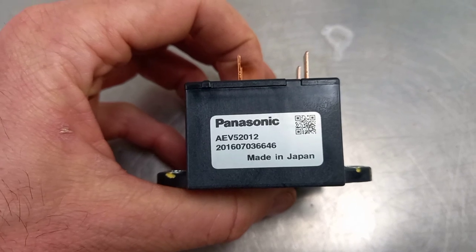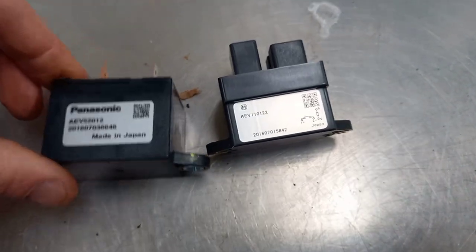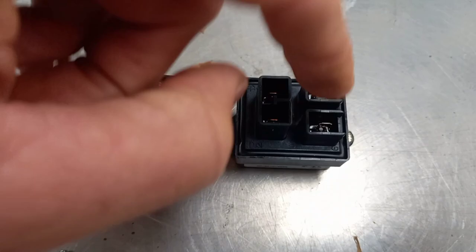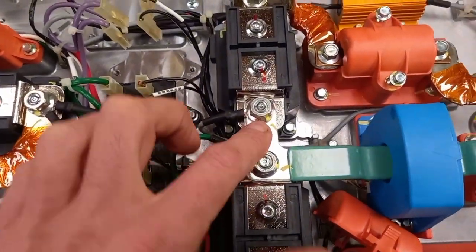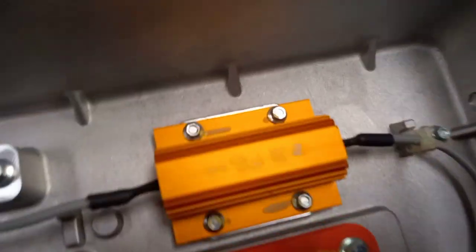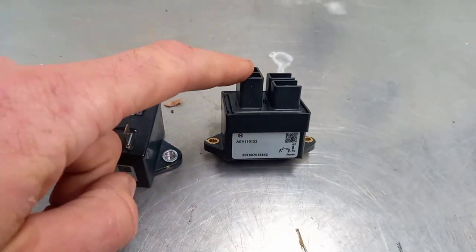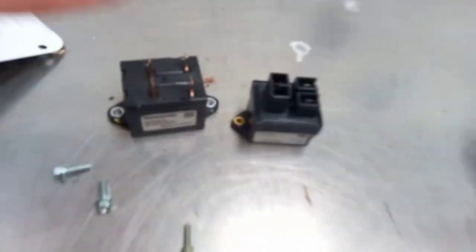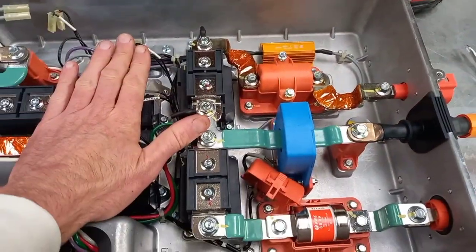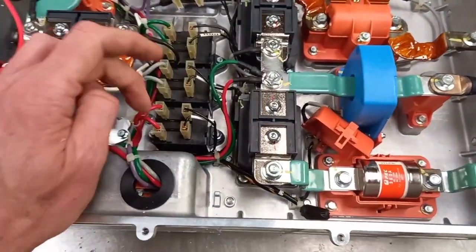As well as these relays for these loads here, I took out that relay which is a fair bit smaller, and it only seems to control the pre-charge resistor. These grays, I've beeped them — they go basically between here and here via that, 120 ohms. So if that's beefy enough to do the pre-charge, then these heavy buggers should be doing more than that — controlling load. So I'm going to stick my neck out and say: high voltage loads, non-drive, such as heating, air conditioning, DC to DC, and miscellaneous.